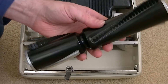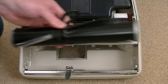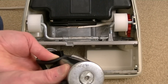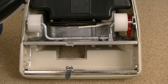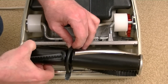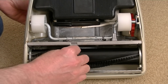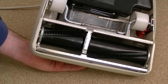Pull out that side first, and then onto the agitator we need to pop the belt through the middle. With some of the Juniors you could put the agitator in the wrong way by mistake, but you'd soon find out because it wouldn't line up with the pulley on the fan. With this one, there's a little oblong piece that's flat on one side, and there's a little groove so we know which way it goes. Push it in, locate it, make sure the belt goes through there, push it down. Then we'll pull the belt through the hole and close the belt guard.